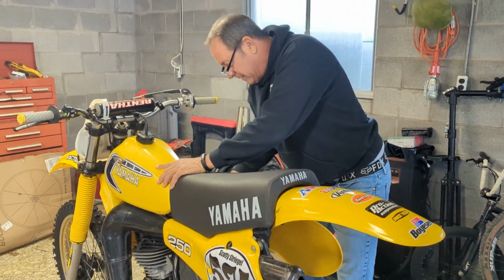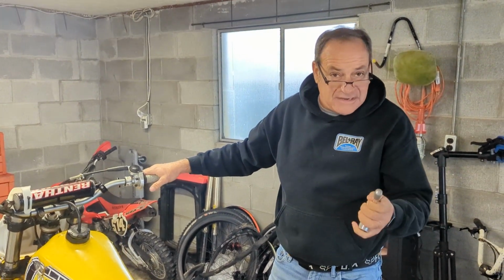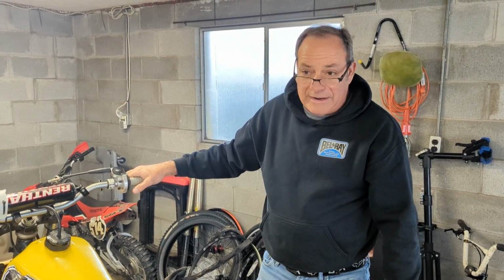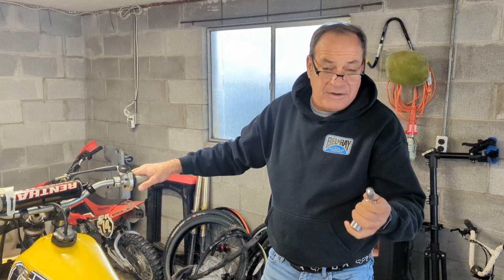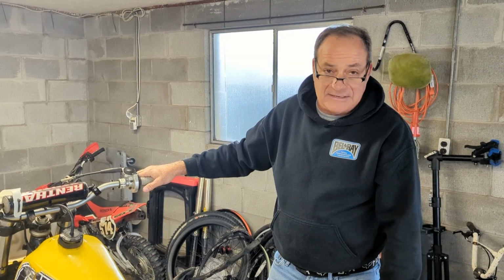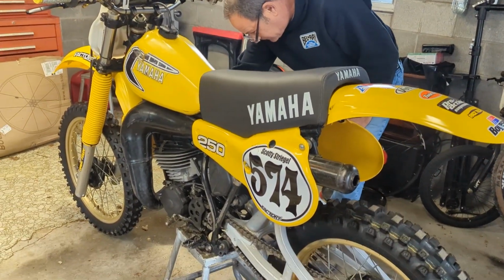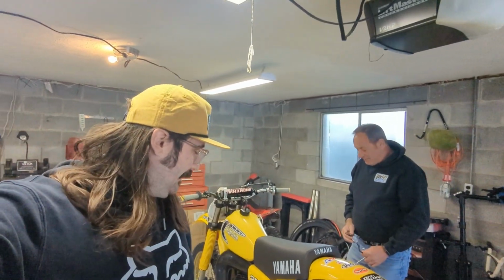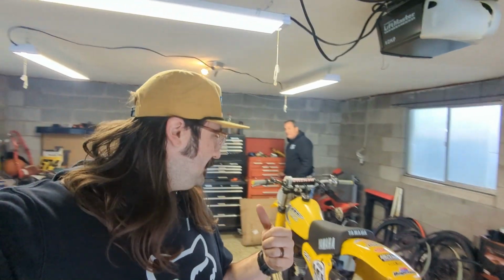I think you had bad gas. I really do. Because whenever I drained the bowl on mine, remember mine was doing the same thing. We drained the bowl on yours. Might have been a little water in it. I don't know what it was, but mine would not run in the first motos of Vintage Days, and we got gas at the same place. I think it was the gas. So don't buy fuel in Ohio. I'm sure their fuel's fine, but it's just weird. It was weird, but it's running. So I guess there ain't a damn thing wrong with this.